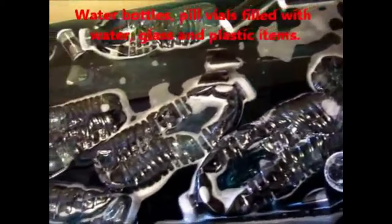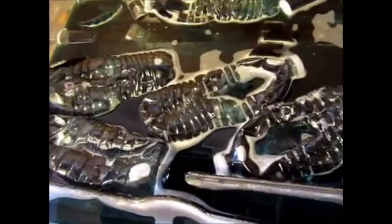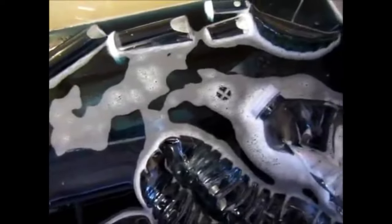The container also has a lot of things in it along with the hood hinges. When you throw rocks into a glass of water, the water level rises. Using that same principle, I took bottles, a couple of vials, and anything glass or plastic and tossed them in with the hinges so I could effectively raise the level of fluid and completely cover the hood hinges — especially the linkage areas where the hinge actually moves.